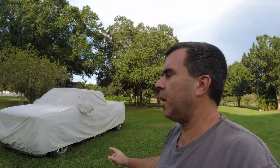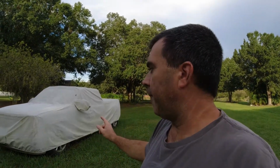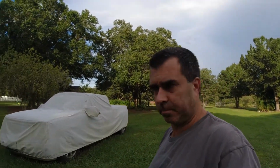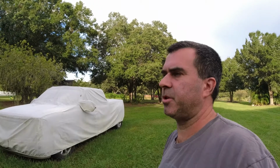I do have another video coming out. I swapped out the front differential on this thing. I do have the parts to do a 4L80E conversion. The reason this thing's been sitting for so long is the transmission is shot. I was driving it for a while, and the transmission got worse and worse and slipping. Now it stopped shifting into third.